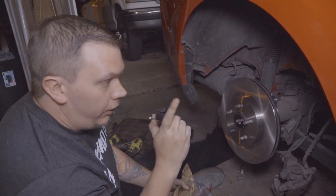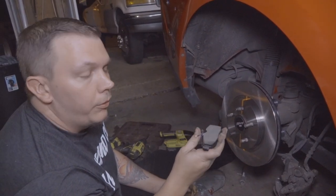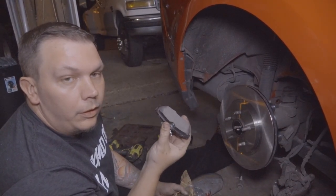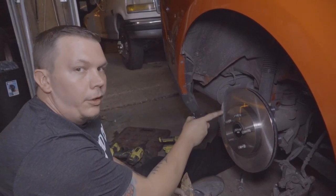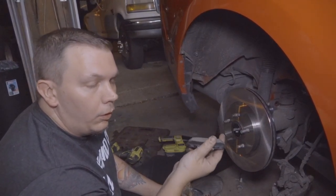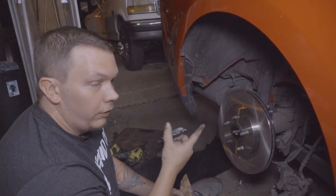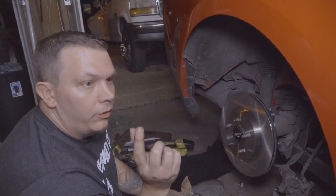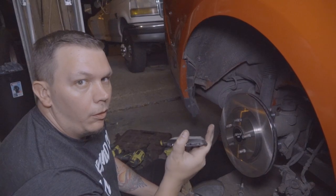On the regular car side, we're going with OEM-style ceramic pads — pretty much all auto parts stores carry these now. On the hydraulic e-brake side, I found AC Delco makes semi-metallic pads for this car — one of the only places that still does. The reason for semi-metallic instead of ceramic is they have a lot more bite and don't require heating up before they want to grab.